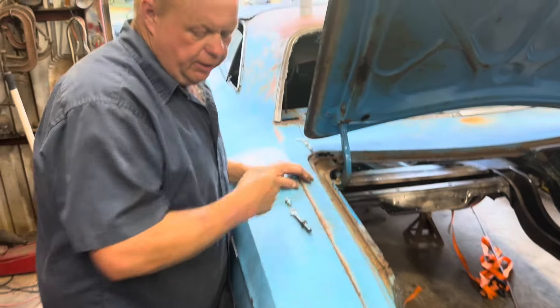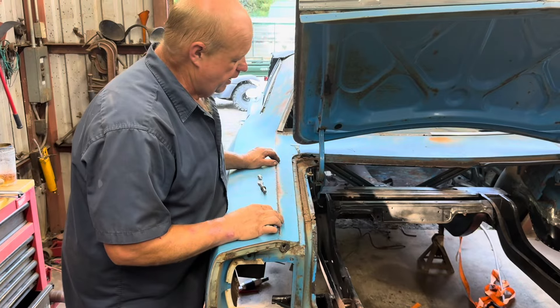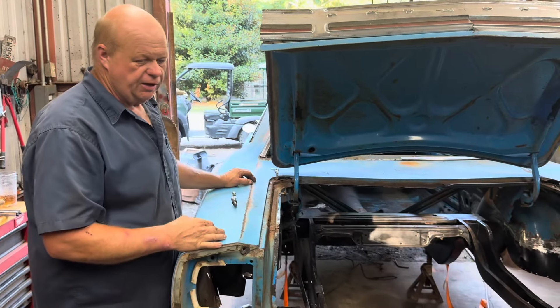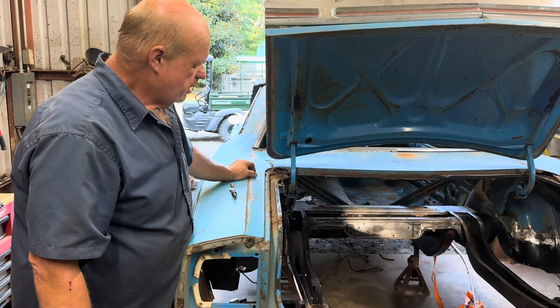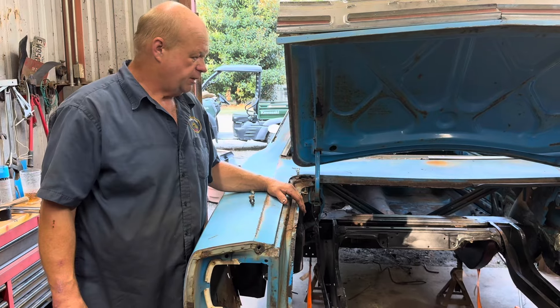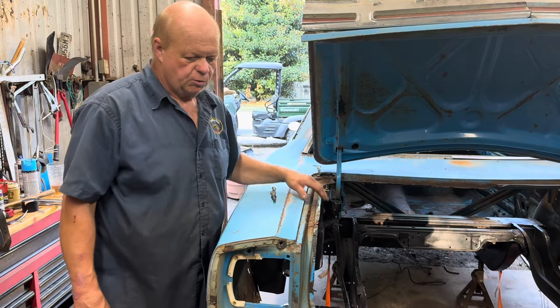I've been under here cleaning all this undercoat from under this car. It had real thick undercoat and I think it was from the factory — it looked like it was. I looked inside the wheel wells where I took some of it off and cleaned it up some. It was pretty thick. I'm going to spray a little more back inside the wheel wells. I know it ain't supposed to have it though, but I think it'll help protect it a little bit. I'm getting it all off the frame and the floor, cleaning it clean and going to paint it back, making sure I get all the rust out. We're going to start drilling some more holes in this pan and clean up these frame rails and see if we can get this thing in there and get it welded in.